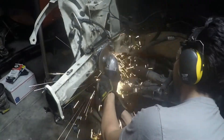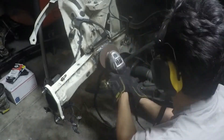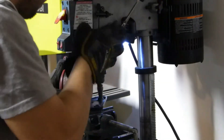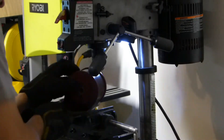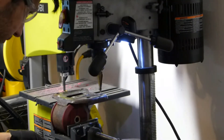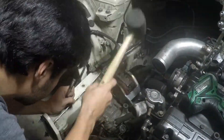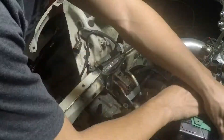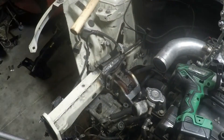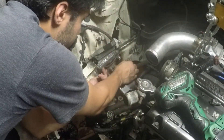We had to grind down some of the proud welds and make sure there wasn't any warpage. We also had to remove the threads from the OEM mount — since it's threaded we won't be able to tighten it down and lock it into the frame rail — so we opened up the bore a bit, as well as removing and shortening some of the spacing so we can use the OEM bolts and bolt straight into the Mini Cooper frame without any extra non-OE-spec bolts. Alignment was a little too perfect and made it difficult to get everything lined up — took a lot of wiggling and jiggling to get all the bolts to fit.